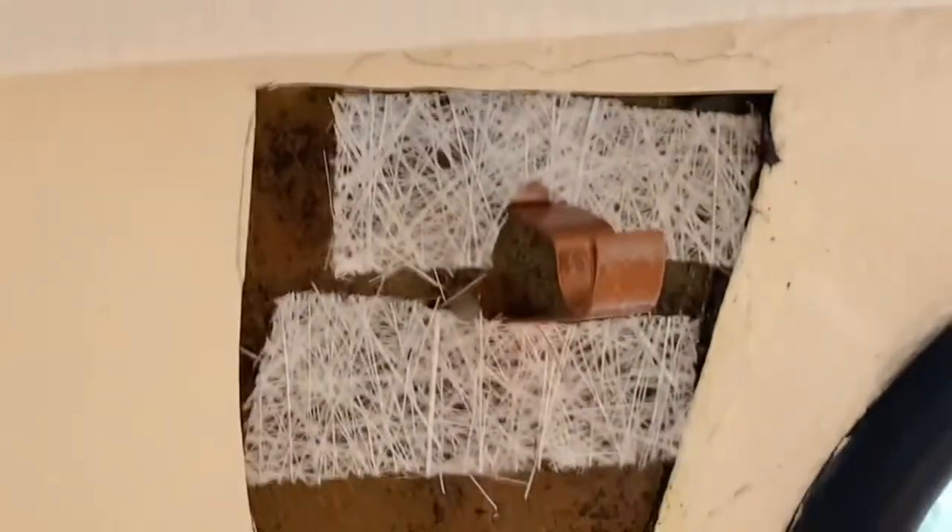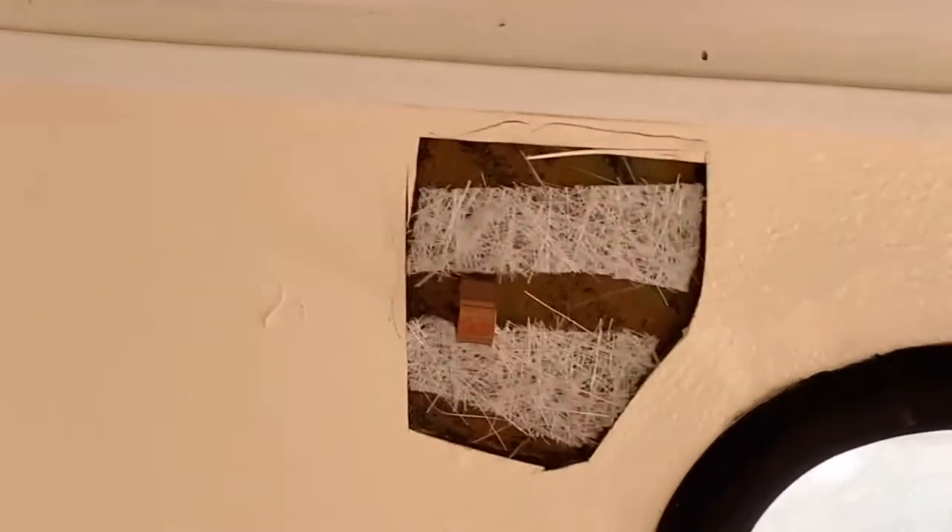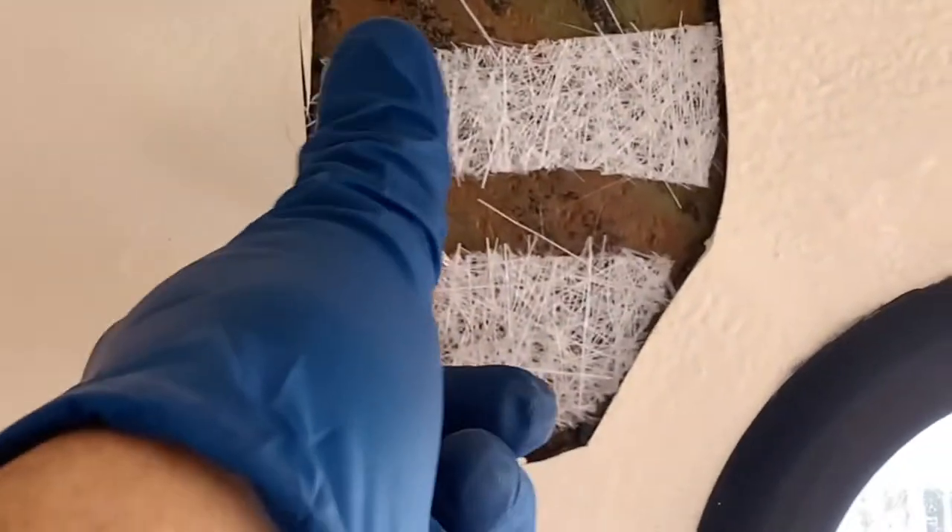There's no resin on this yet - I just wanted to show you I pre-cut my fiberglass pieces to get the most out of them. See how that goes over the top and down the sides? I cut them all to fit; they're just sitting in there on their own. This one I overcompensated - I should have made it a little bigger, but I didn't want to keep cutting. So I have a seam I'll have to seam seal, but these will never come off. Most people won't even be able to pull this fiberglass off.